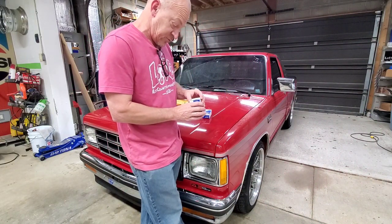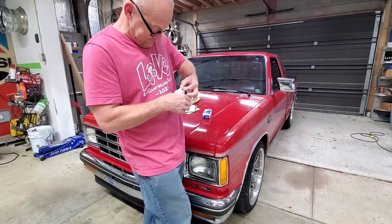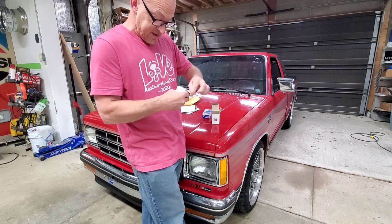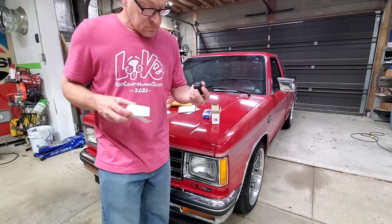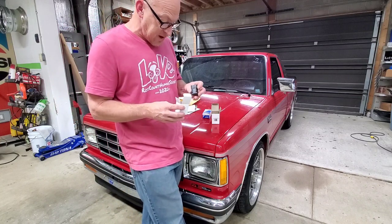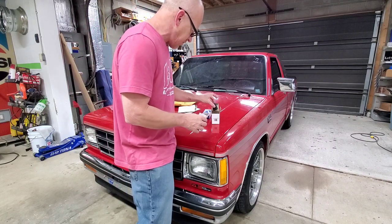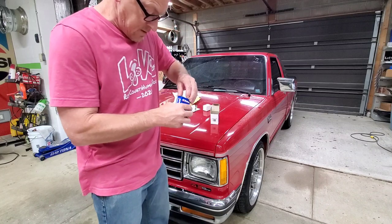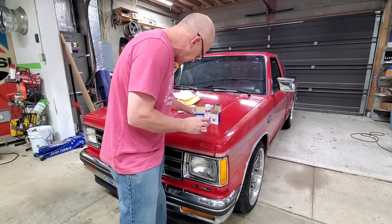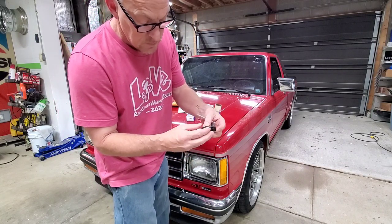We got the parts to fix the D90, I'm assuming. They don't have no labels on them, so I don't know what's what. It's a box inside a box — this must be the relay. Made in China — a Chinese box dropped in an AC Delco box. Anyway, this is a fuel pump override overheat relay, something like that. I don't remember the exact name, but we're going to switch that out because that was one of the codes that came up. And this is a bag in a box — we got some screws, and this is the TPS, I believe — throttle position sensor. I'm going to switch that out too.